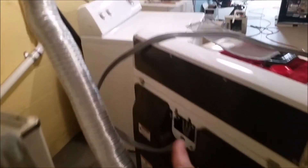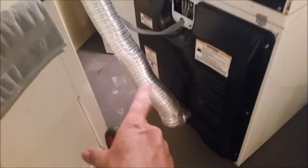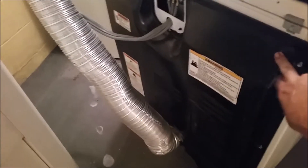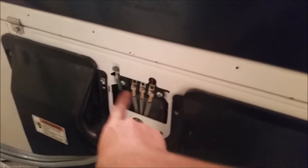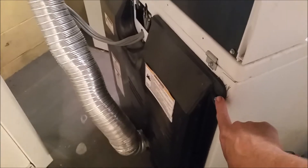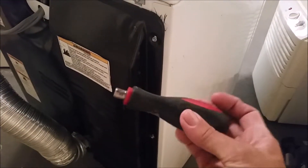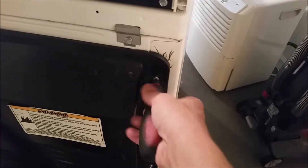The first thing to do is to make sure that your dryer is unplugged from the wall before you proceed. You can sometimes get by without disconnecting the dryer vent, but other times you may have to take it off to be able to get this back panel off. It's real simple - just usually a few screws covering up the cord panel and then all around the perimeter. The edges are machine stamped and can be sharp, so you may want to wear leather gloves. It's normally a six millimeter nut driver.